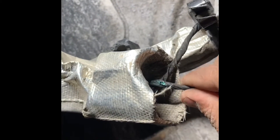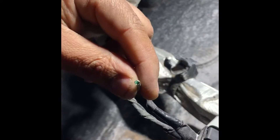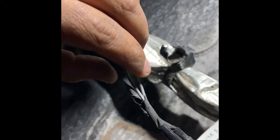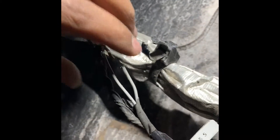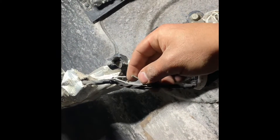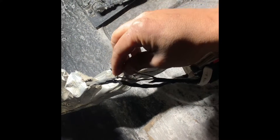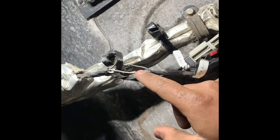What you got to do is cut the tape around this and we're going to make sure we repair that. After peeling back the tape, we found that the wire had been broken open like the computer said. Usually you want to add a little bit of cable so we don't change the length on the whole harness. We came across the corrosion — the green crust — and we're going to have to fix this. Cut a little bit back in order to cut off the corrosion. On both sides we're going to have to add a little bit of cable in order not to change the length of the wires, so we don't put any tension on any other cables.